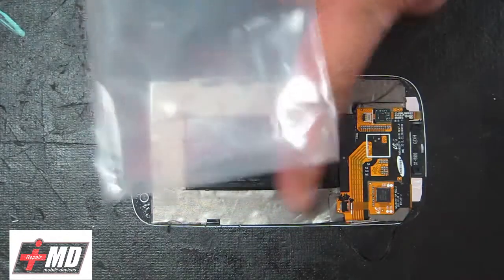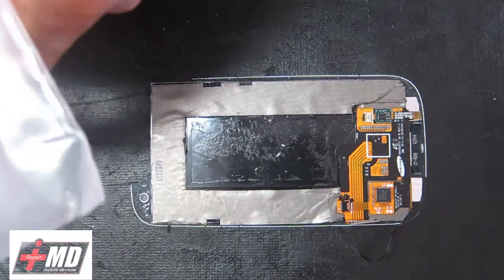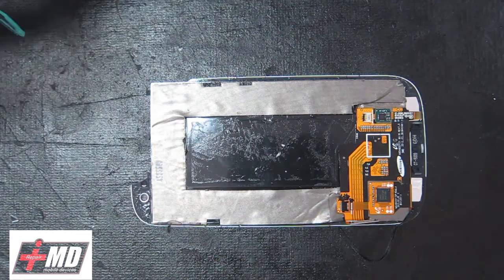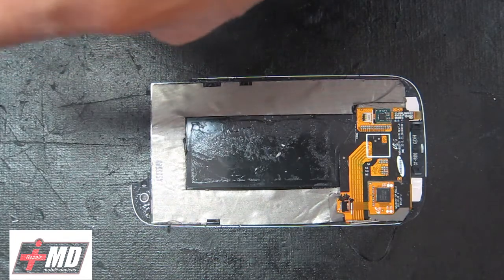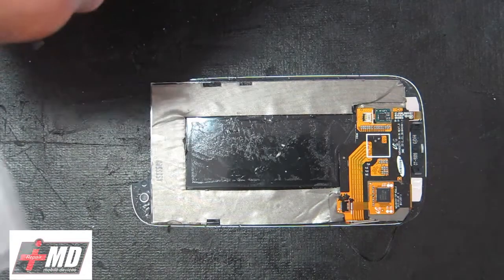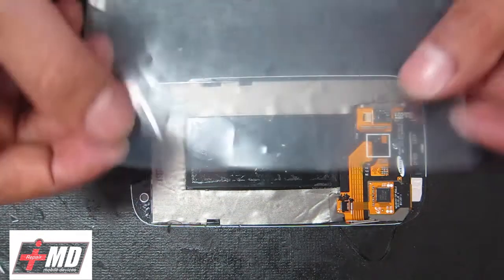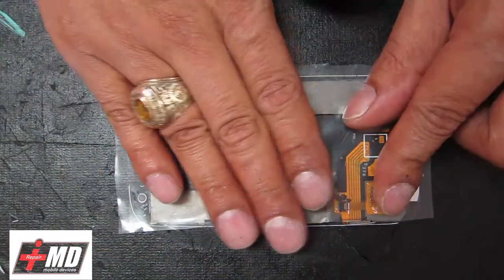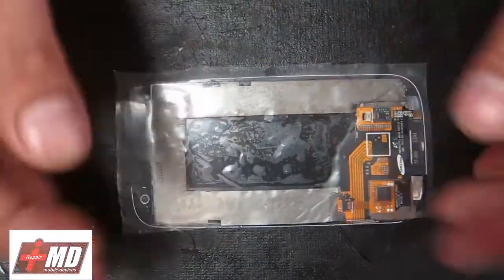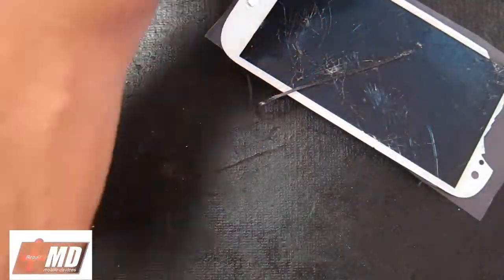It's been five minutes, so now that the alcohol evaporates, everything back there is going to be pretty tacky. So I'm cutting a piece of plastic to protect the display and prevent any particles from sticking to the back of the display, because it might damage it if you mount it and people keep having regular traffic on it. So what I'm going to do is seal it off here, and let's go ahead and test this display to make sure it works.